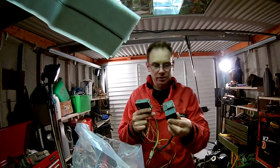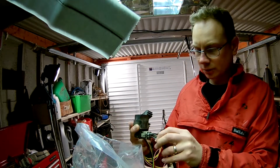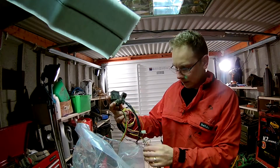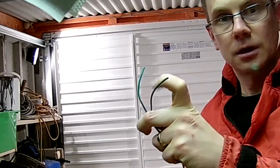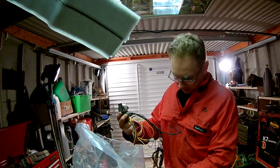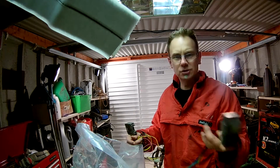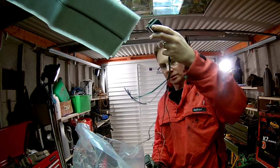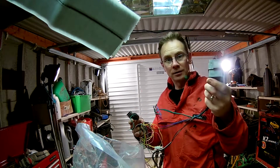So just to elaborate, we've got the CDI unit here. It's a 6 wire. So you've got a trigger wire which is fired off the engine bay, which is one of these two. You've got a couple of earths that need to be fed to the chassis. That's those two cheeky little numbers there. So that's the CDI taken care of. There's also a couple of very random ones which I think are kill switches and something else, I'm not entirely sure. And then you've got one that feeds the coil. I'll go through this again in a moment once it's all on the bike.